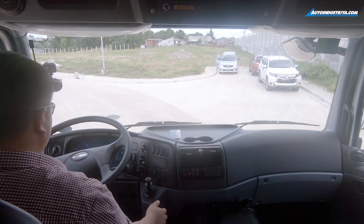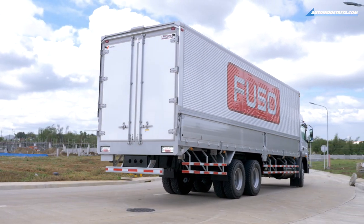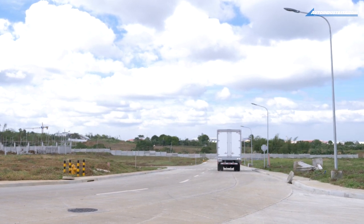We're in first gear. That's a really big steering wheel. Being a big heavy truck, the rev range is not very long — max power develops at 2,200 RPM. You really want to keep it between 1,000 and 1,800 RPM maximum. We're into fourth gear — still learning this as we go, but surprisingly manageable.